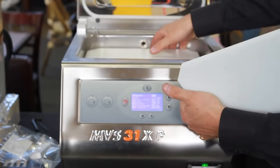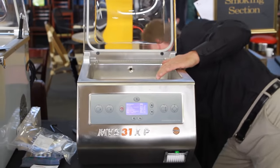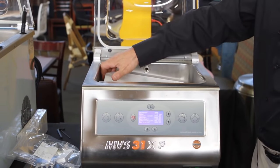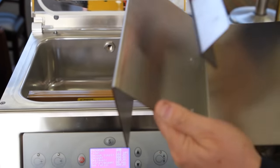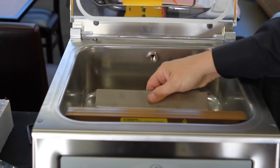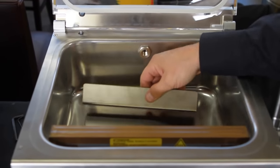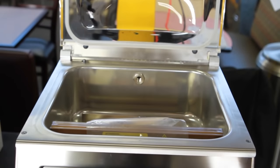If you're looking at doing more items like sous-vide or liquids, you can take your volume plates out like so, and place your metal tray inside. This new metal tray has an adjustment for the bag height. This will eliminate any liquids falling into the chamber of the machine. With a chamber machine, you can actually do liquids where you can't do it with a non-chamber vacuum machine.